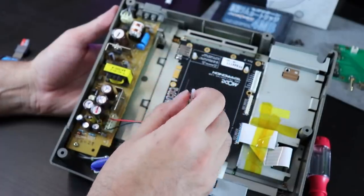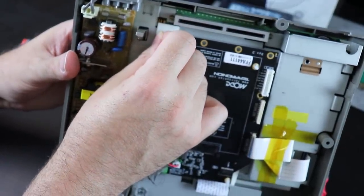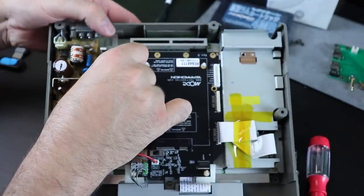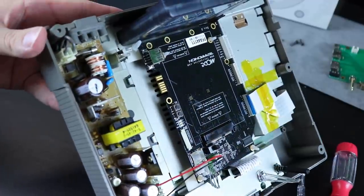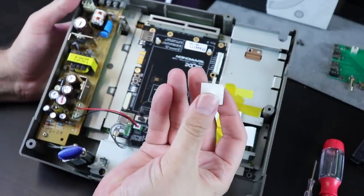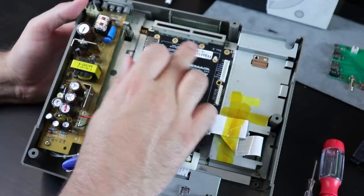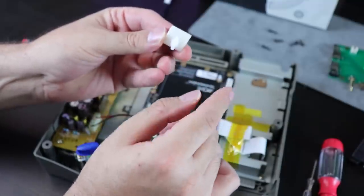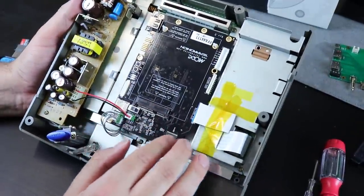These little posts — you may have already noticed I don't have them in the correct spot for the top. I've oriented this every which way I can, and no matter how I put this thing in here, if I have those posts unmodified at the top, it gets in the way of the cartridge slot. So if you're going to use a RAM cart, backup cart, or whatever, it will push up the MODE and it will not make a full connection — it may cause it to not work. You may have to trim a piece off or move them. I moved them down, which would get in the way if I use a hard drive. But no matter how I put it in, they were in the way and a cartridge would not make a full connection.